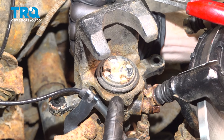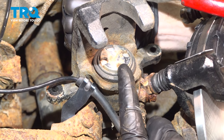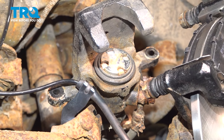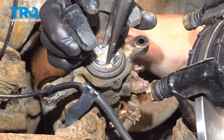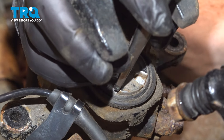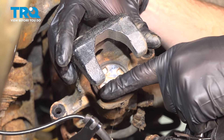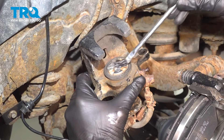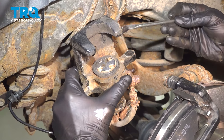Let's pay attention to our caliper once again. Looking at the piston, you want to make sure that this is pressed in as far as you can. What you'll find on this particular type of caliper is you can't just press it in like you normally would — you have to twist it as you press it in. There is a specialty tool for this, or you could just use some long nose pliers, coming right inside of each of the grooves. Just be careful for any pinch points while using the pliers. Once you have it pressed in as far as it can go, it's important to make sure it's properly aligned so that your slots are facing up and down and directly side to side, not forming an X. Continue on with some high temperature caliper lubricant — lubricate the piston and along the backside of each of the two ears. This will help with vibration dampening and noise reduction overall.